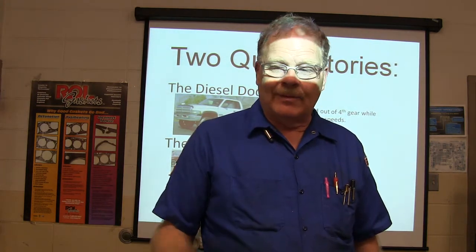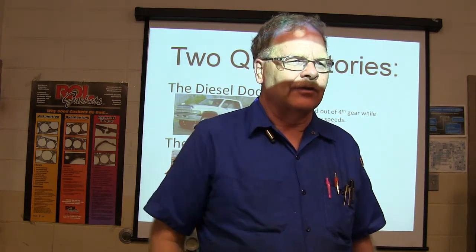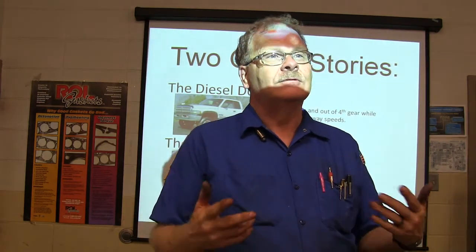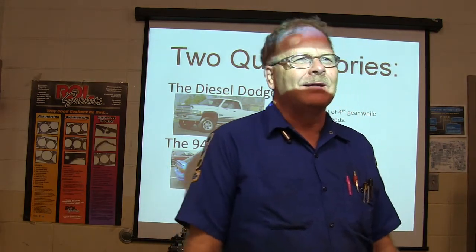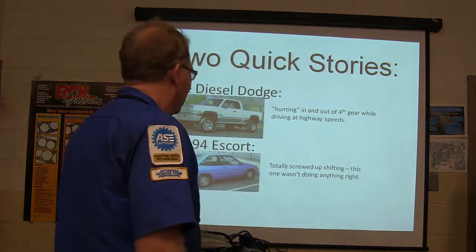And so they brought it to me, and I pulled up a technical service bulletin, and it said, if you've got a Dodge truck like this hunting in and out of fourth gear, go ahead and reflash the engine controller with this particular calibration. So I did and fixed it that way. They bought me a steak dinner. I mean, it was through in 30 minutes, and the guy bought the truck, and they were all happy.